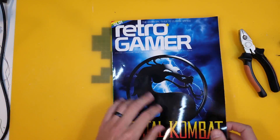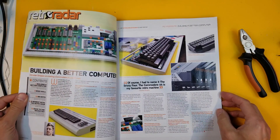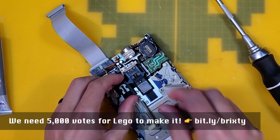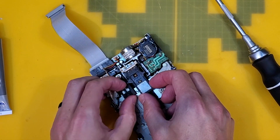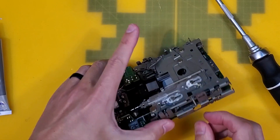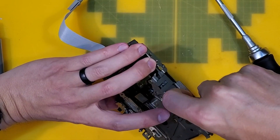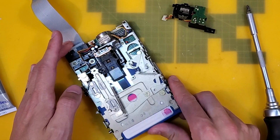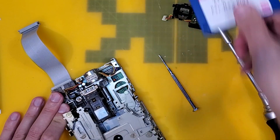What's this? Oh, it's some kind of Lego Commodore 64 article. That looks pretty cool — I'll probably vote for that at lego.com. Here's the drive. To refurbish one of these, first we remove this black clip that keeps the drive head up away from the disc. Then you detach just these two springs, which are all that's keeping the top piece of the mechanism in place. The top piece is easier to remove when the disc is in the ejected position — pop a disc in, eject it, and it comes right off.